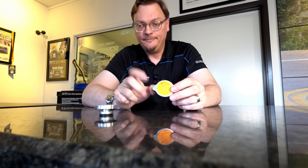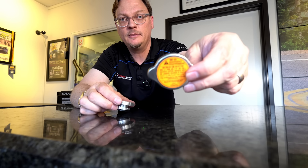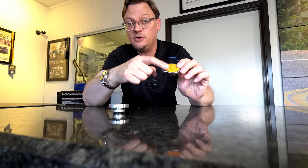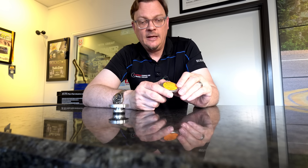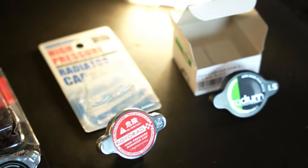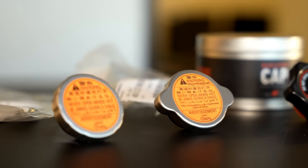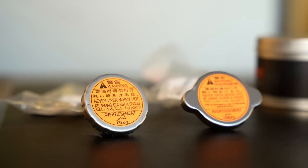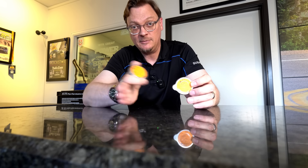Now, there's a difference in pressure here. The one on the radiator is a 1.3 bar cap, and it's a 1.1 bar cap that is on the expansion tank. You want the cap on the expansion tank to be lower pressure than the one on the radiator, because you want this one to open first. If you've got any air in the system, that's going to be at the high spot — you want that cap to open and let that air out. That's what helps the system self-burp. Can you run two caps of the same pressure? As long as you just have the one two-way cap, it seems to be okay, but it's more ideal to have the lower pressure cap on the expansion tank. What you just cannot do is have two two-way caps on the system at all.